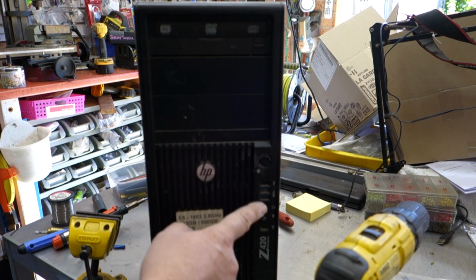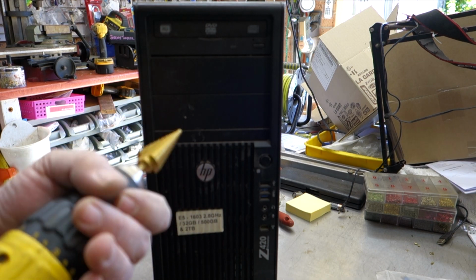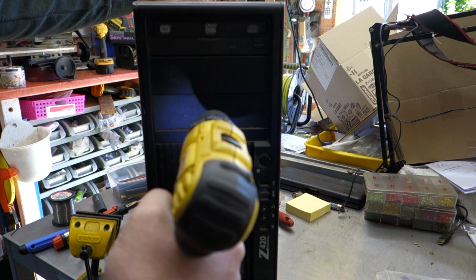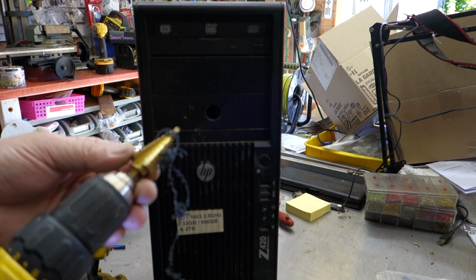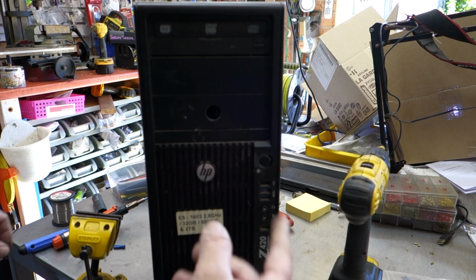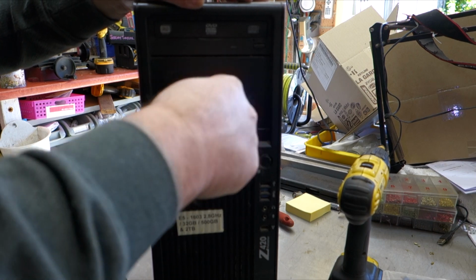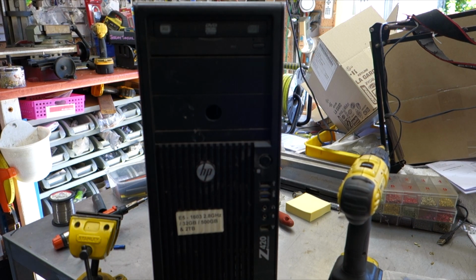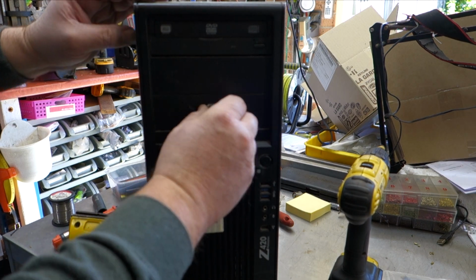Okay, so we've got the button wired up, we've got the right spot for it. Now I know it's only plastic and it's really just a child deterrent. I'm going to use the Christmas tree, go through here and make a hole. So this is a 9mm cam lock, but I'm going to take it up to 18 and then just do it by hand. Okay, 18. I mean these locks are designed not to roll, so they really should have the straight sides, but for what we're doing it's going to be tight enough. I'm using a deburring tool, taking it up to 19mm. So there we go. Oh, look at that, perfect.